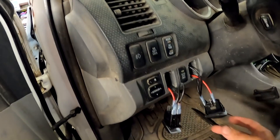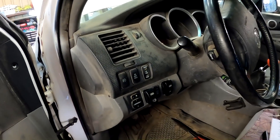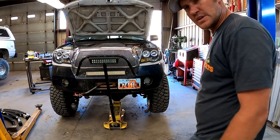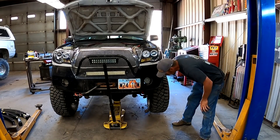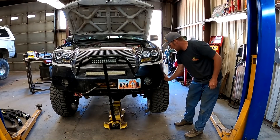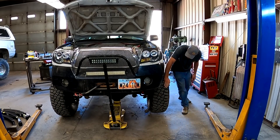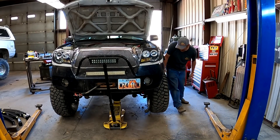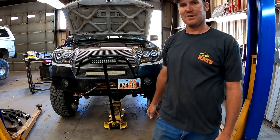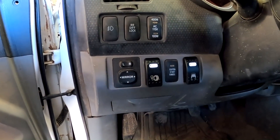This is my current status — I'm wiring. These are going to go in the dash right here. I just got to get 12-volt key power and this thing's done. We got this thing wired up. Right now it's unlocked — hubs are in. We'll flip the switch — now we're locked up. Flip it again to unlock it — free. Life is good. That one turns the compressor on and that one locks the front end in.